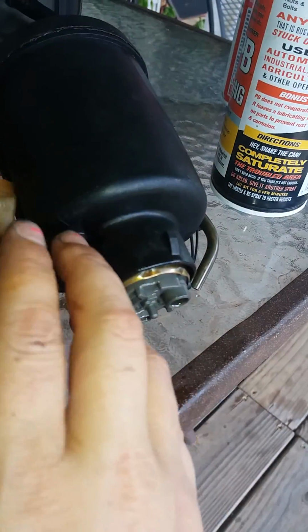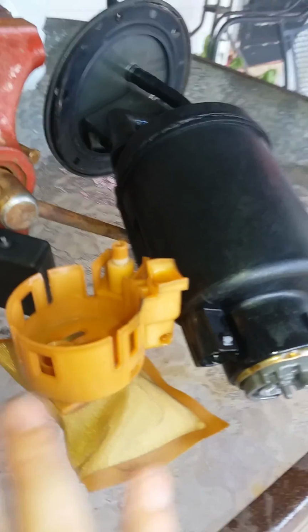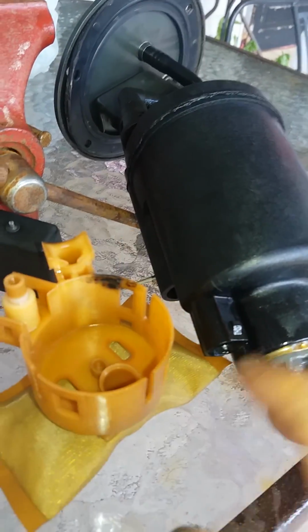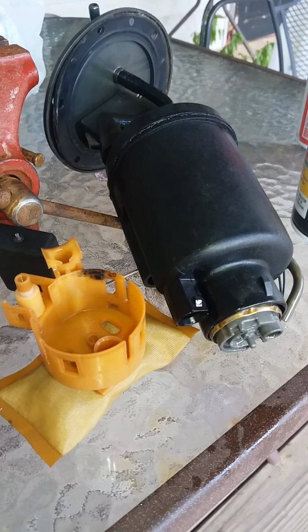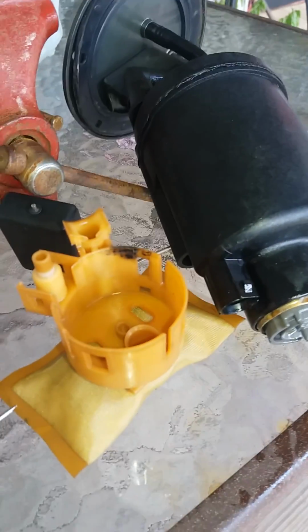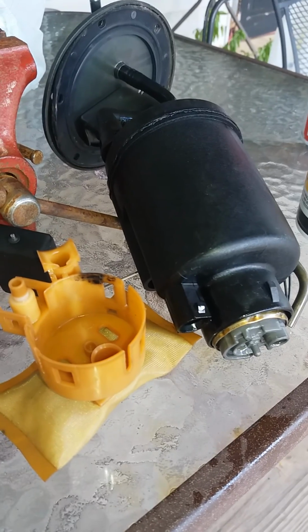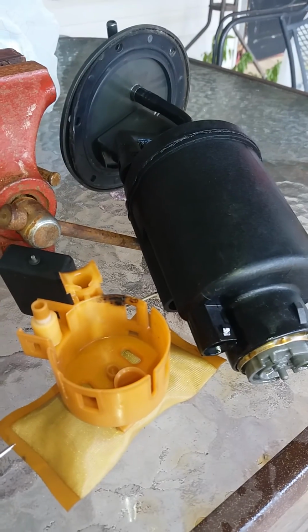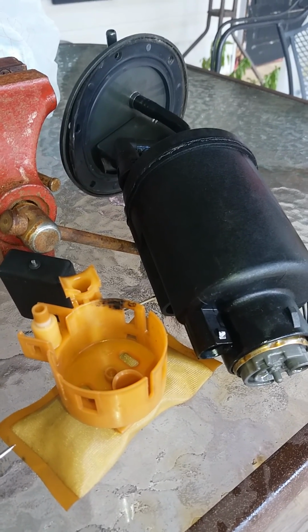just in case this isn't the problem. Must be something else, like a relay switch, or maybe my injectors aren't working right. So it could be a multitude of things. But I guess I'll let you know whenever I figure it out. The hesitation, rough idle, high idle. I've replaced the throttle body sensor, or the TPS, and an oxygen sensor, which was not looking well.